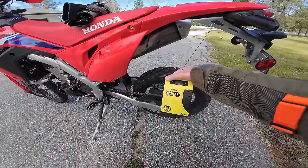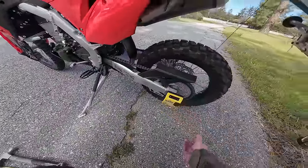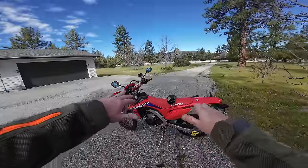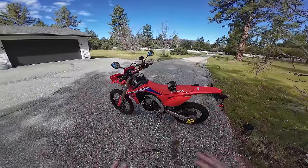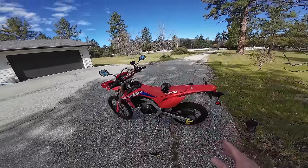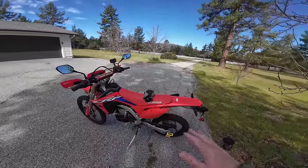I'm not sponsored by this company — I paid for this tool, and I absolutely find it indispensable. The thing about sag is that when a motorcycle doesn't have the right geometry front to back, the balance is off and it throws the handling way off. I looked up the recommended race sag settings, which is you sitting on the bike with all your gear. It says between 95 to 115 millimeters. I want to shoot for the middle of that, so maybe around 105.